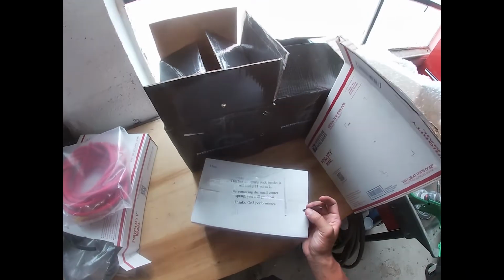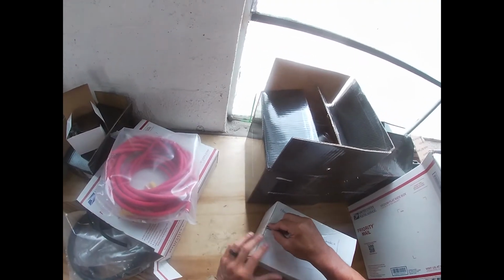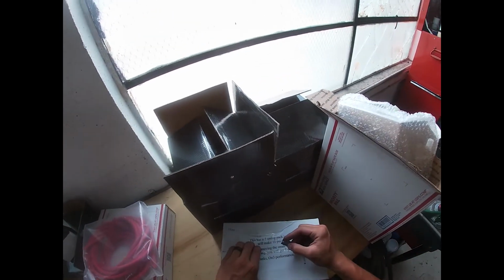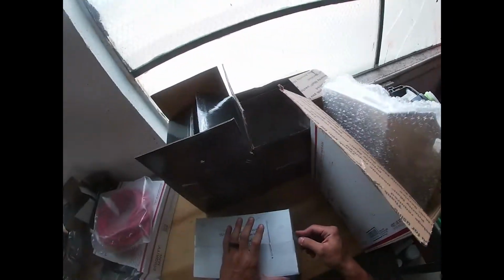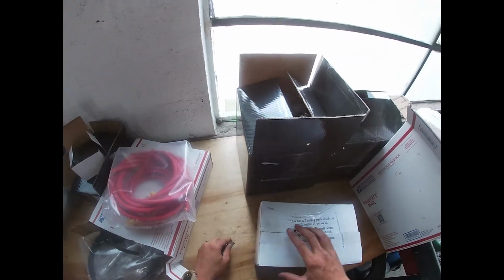So the wastegates go up to 11 psi. You move the center, you get 7. I could have got this kit a little earlier, but they were on back order for the wastegates. That's another thing too. There's also an overflow tank that's supposed to come here, but they are also on back order. So I will keep pestering these guys until we get those, because it looks really nice in the engine bay. So we'll open these.